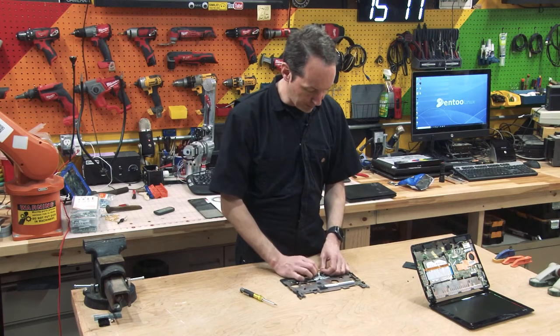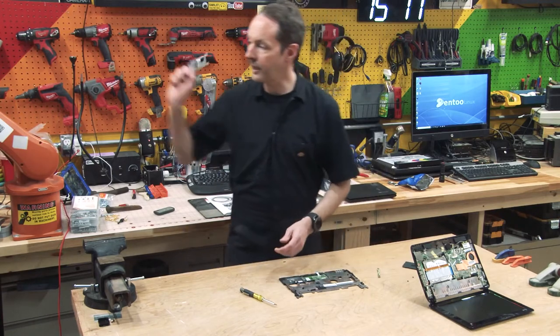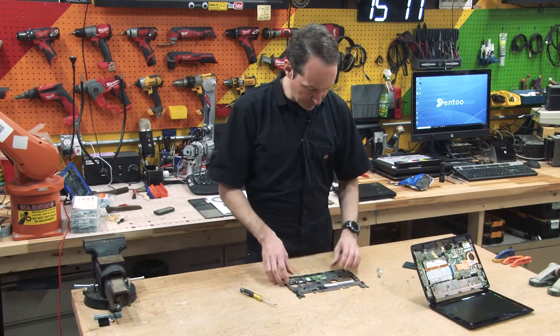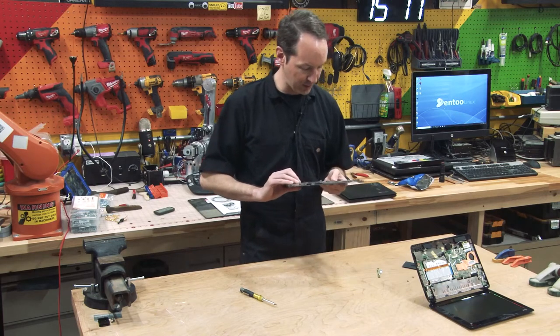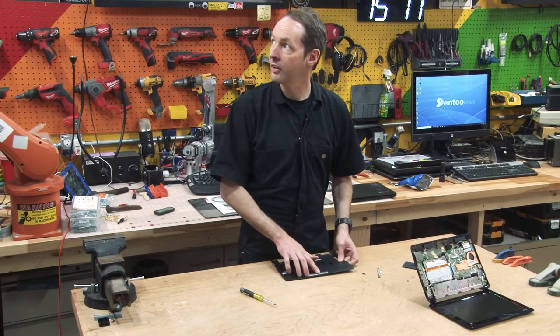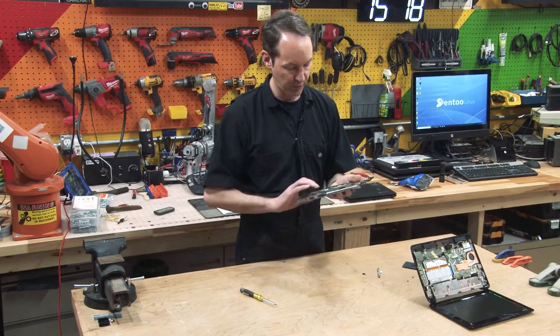Basically, everything inside here works up in the megahertz and the gigahertz, and there's a lot of radio noise. So for them to get legal in selling them and making them, they have to do everything they can to reduce the amount of noise that it makes. Now, this is neat. This is all one piece of plastic until here. The button is a different piece of plastic. And on the back, it's a totally different thing. Like, there's a sensor for the touchpad on the back.